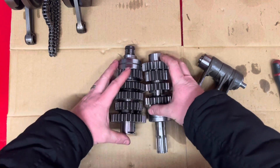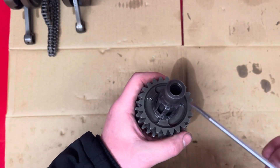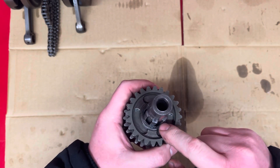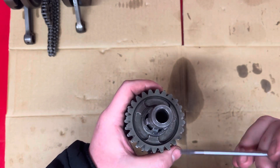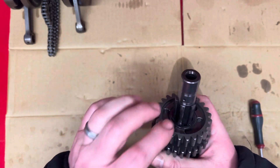That's a quick run through the gears. One last thing I wanted to add — if you are going to replace the circlips, just replace them. Don't ever reuse these gearbox circlips. We should never reuse any circlip really, but especially these ones.